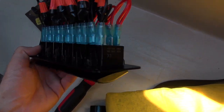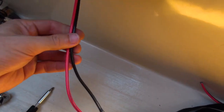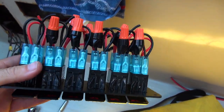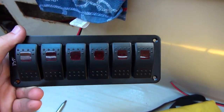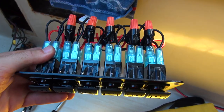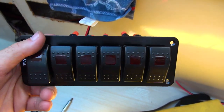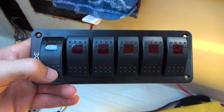Unfortunately it turns out these wires are actually 18 gauge, which I'm pretty disappointed with. It doesn't really make any sense considering the switches are rated for 20 amps and they're handicapped with 18 gauge wire - that's kind of stupid in my opinion, especially considering I went and bought 12 gauge wire. It kind of defeats the purpose when you have the last leg as 18 gauge. 18 gauge - max you want about 5 amps, if that. So it looks like anything I have with this panel is going to have to be low current. It'd honestly be better if they didn't come with all these connectors on them, because I'm afraid if I start ripping the connectors off, the actual plates on the back of the switches will rip out with them - as I've heard it happen to a couple people. So I'm just limited to about 5 amps per circuit on this.